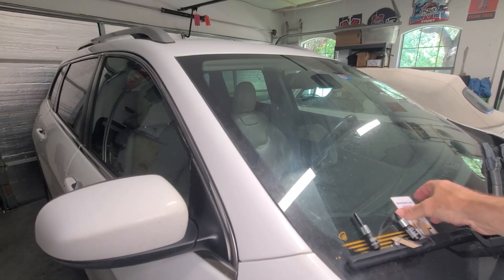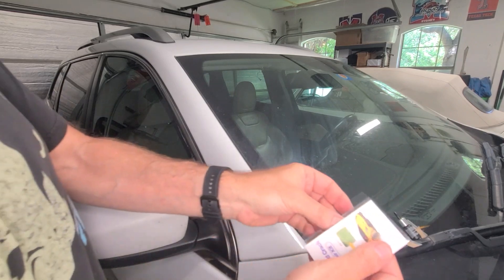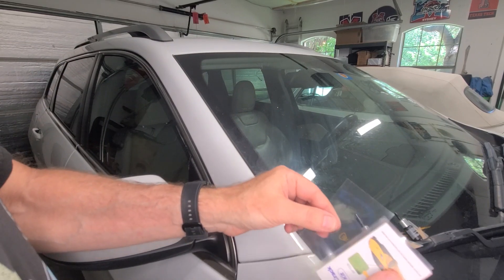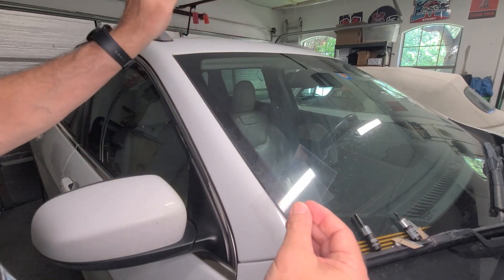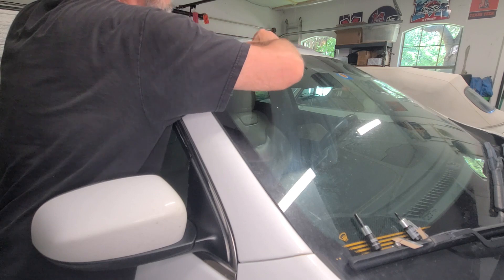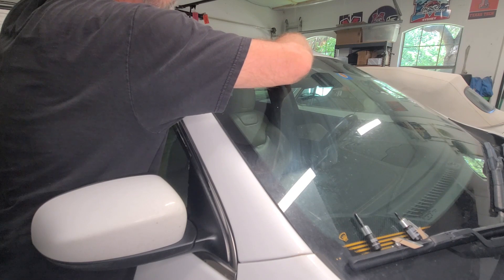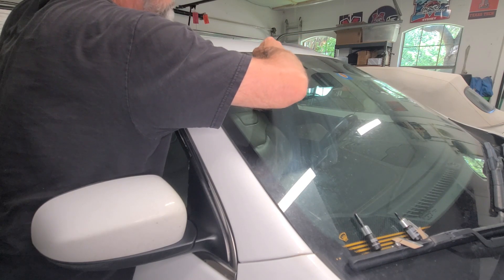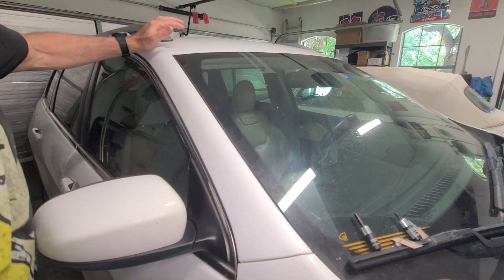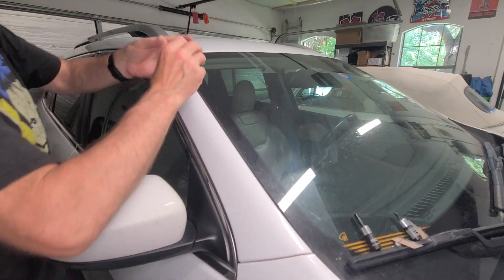On this next step we're going to put these little clear plastic sheets over the top of the area where we put the resin. That's going to hold the resin in place, then we're going to back the car out into the sun. I think maybe three of these should get me where I need to be — I don't want to let them overlap because then you'll get a groove. They can go edge to edge.